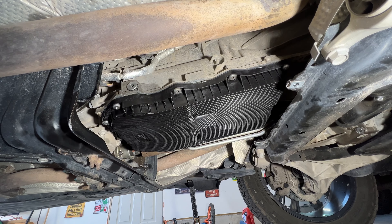Now we're sitting at 98 degrees and climbing, so I think we're good. Let's check how much we put in — so that little amount I just added: here's half a quart, here's half a quart, so we're right at four and a half quarts total. And like I said before, we were just a little over four — maybe four and a quarter — but I spilled a little bit, and there's a little left in the filter. So I think we're good sitting at four and a half quarts.